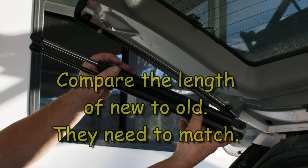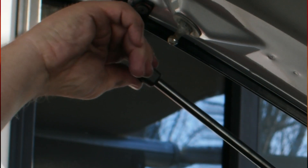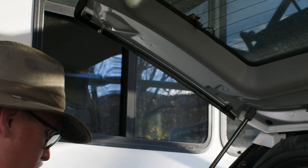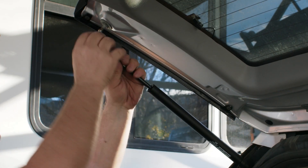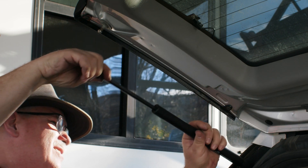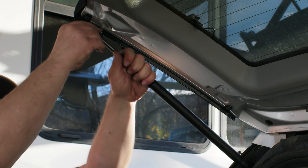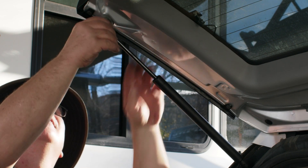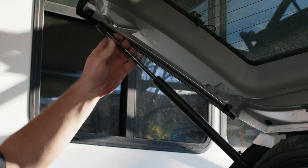The new strut will need to be adjusted to line up with the ball mounts. Whatever you do, don't unscrew the ends — instead, turn the rod tightening the ends until they line up with the ball mounts. Take the new strut and place the end on the ball mount, then with the heel of your hand, tap the end onto the ball mount. You should actually hear it snap onto the ball mount. Gently tug on the end to make sure that it is secure. Do the same thing with the other end of the strut. You may have to lift on the hatch to get the ball mount and the strut end to line up, but just turn it in a tightening direction only.